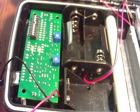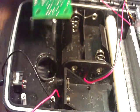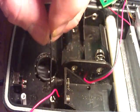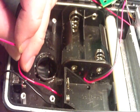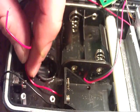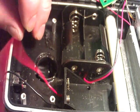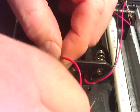I'm going to start with the board power. It's under my board and I want to get it out of the way, so I'm going to pull the board off. What I want to do is take my positive wire to my switch, so I'll need to cut that. I already tinned the wires and the terminals on my switch — I pre-tinned them so that I'm ready to solder everything on. Now all I need to do is cut the wire to the length I want it, right to that switch.